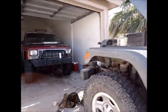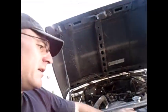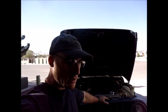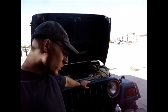I have the Ford 8.8 under there with an axle truss and I'm running the Dana 30 with G80 up front — so a limited slip in the rear and a G80 locker in the front. I did a test the other day with 86 octane, towing my trailer a little bit with a four-wheeler, motorcycle, and about 200 pounds of other stuff on it. I was getting 19.8 miles per gallon in El Paso — that's at 60 to 65 miles an hour on the highway with a lot of stop and go. Without the trailer, I got 23 miles to the gallon doing 70 miles an hour on my trip up to Alamogordo and back.